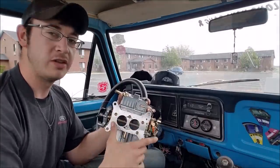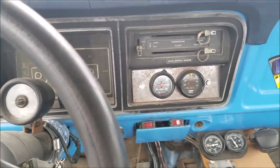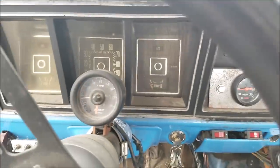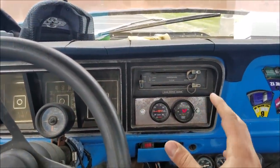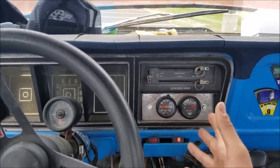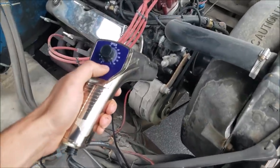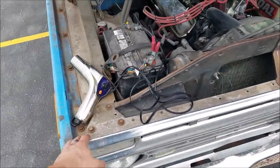Let's jump out and demonstrate this at idle. We'll manipulate some things and see how the engine responds. This is going to be our baseline — we've got our engine up to temp and idling. Our air-fuel ratio is about 14 or so, manifold vacuum is hanging out at about 20 inches of mercury, and we're idling at about 700 RPM. Our initial mechanical timing is 8 degrees. We're going to retard it to 6 degrees and note the changes on all of our readouts.